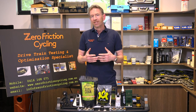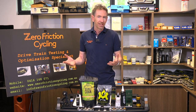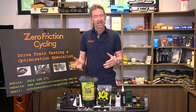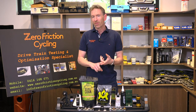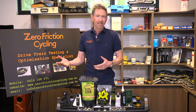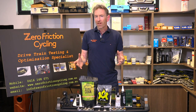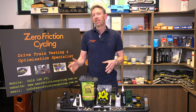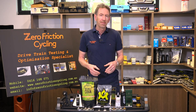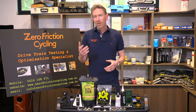Unless you're putting about half a bottle on for every short ride, your chain wear rates are going to be very high. They're a lubricant where beauty is only skin deep. I get to see a lot of customer bikes come in, I check their chain wear and marry up the lubricant to the wear rate. Both from test data and real-world customer data, I haven't seen one yet without atrocious wear rates. My advice covering traditional dry lubes: avoid them — they are nothing like the latest generation chain coating type lubricants.